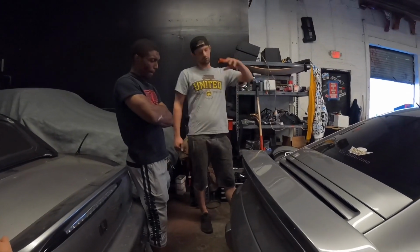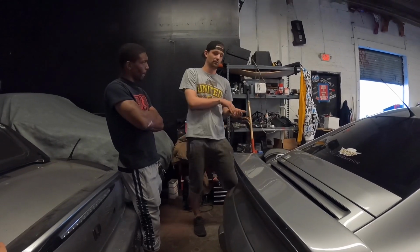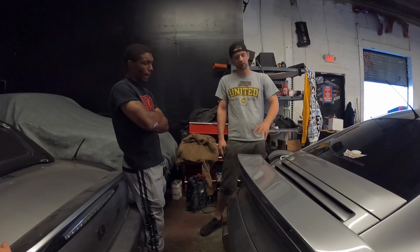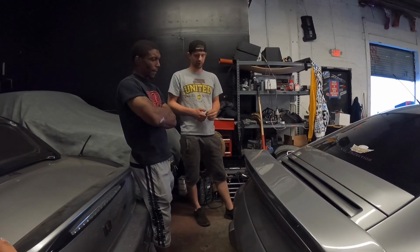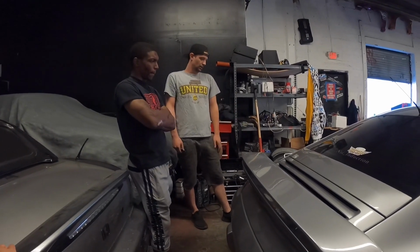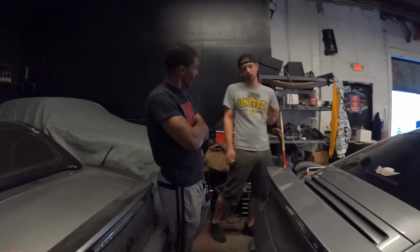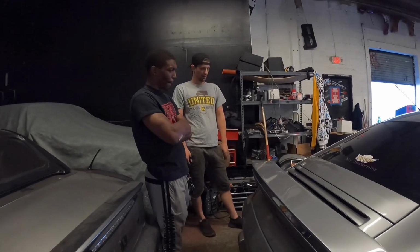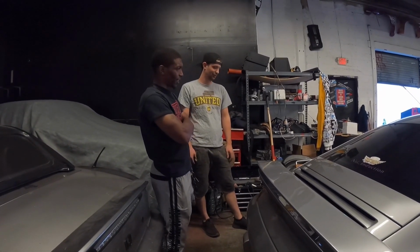Then going more into the VTG hybrids and stuff like that, which we're leaning away from for many other reasons. I would love to keep the stock airbox, but eventually we're going to run into the issue where it's going to have to go, because we're going to do the 3-inch Y pipe on it, which we have made. It just fits with the airbox badly, and it rubs all crazy. So I took it out and put the stock Y pipe back in because it destroyed it. It's made out of titanium, so it's really pretty, and I don't want to scuff it up.